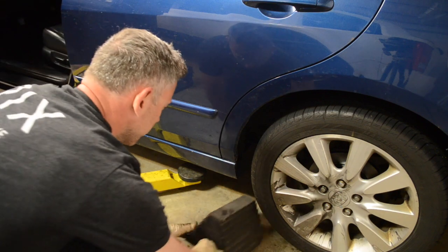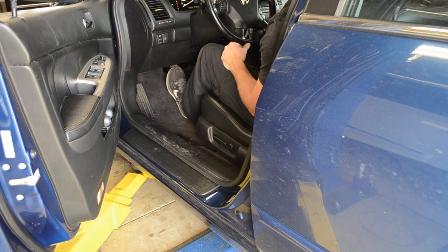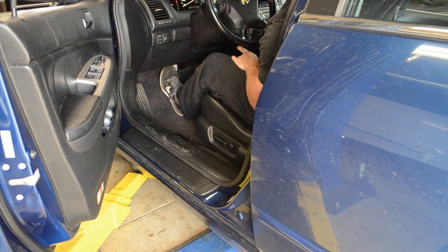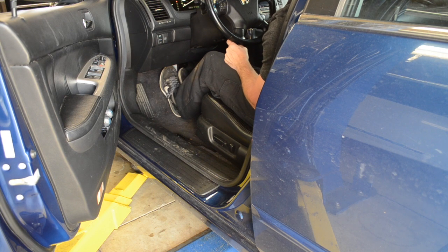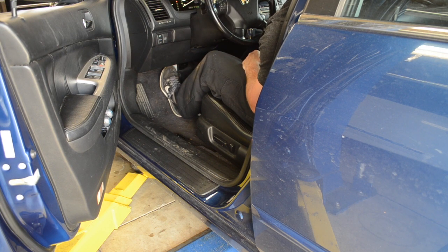Before performing this next check, I'm going to go ahead and block the rear wheels. We're in the car, the engine's running. I've got my left foot pressed firmly on the brake, and with my right foot I'm going to give it some gas with the transmission in drive — which is why I have the block in front of the rear wheels and the emergency brake also engaged. That way in case my foot slips off, I'm not going to drive through my toolbox.